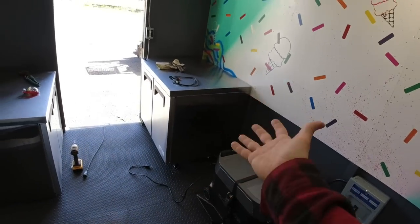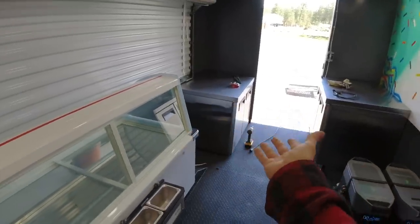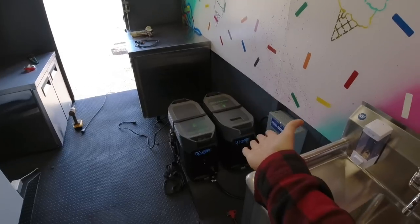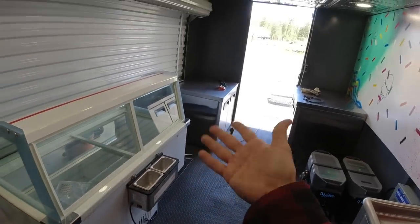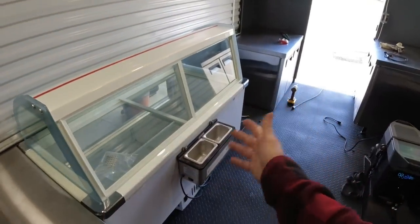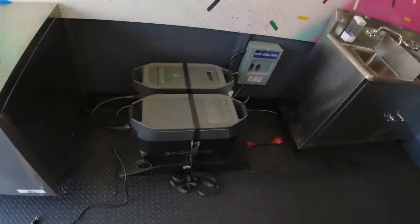It's going to be a little bit difficult because fridges and freezers don't run all the time. From my previous testing, I found that my fridge is only running between 10 and 20% of the time - it cycles on and off. As soon as the temperature is down it turns off, as soon as the temperature goes up it turns back on. The full load of turning everything on to get it to cool down is going to be much higher than the load required to keep it cool. And it's also going to change as people are opening and closing - every time you do that, as I'm sure your parents taught you, it ends up using more electricity. So first things first, let's get this thing full and then we'll start to put it through its paces.